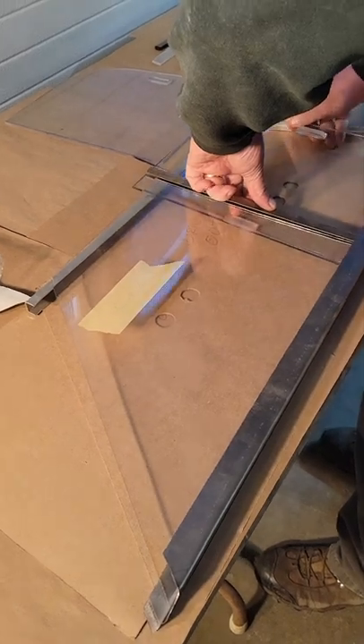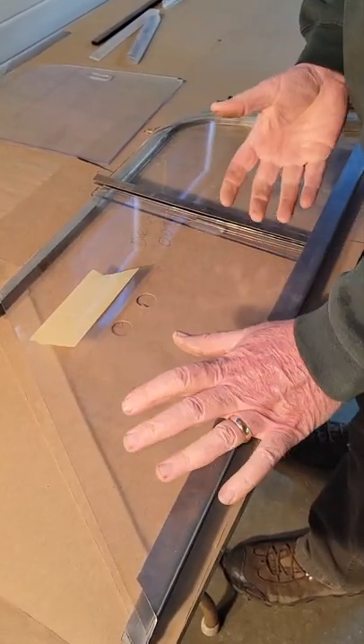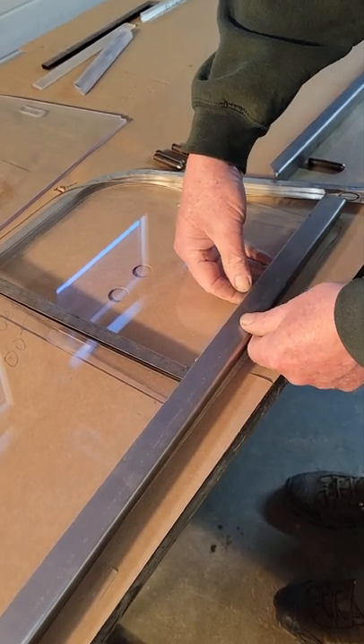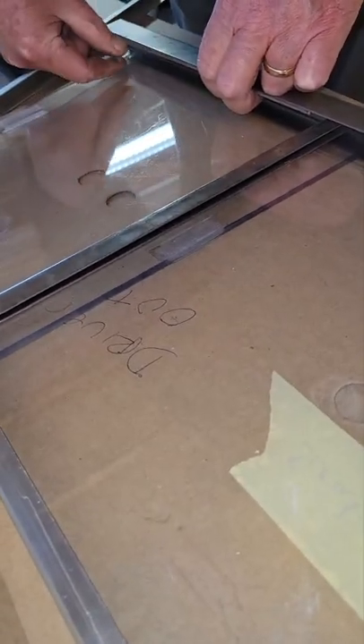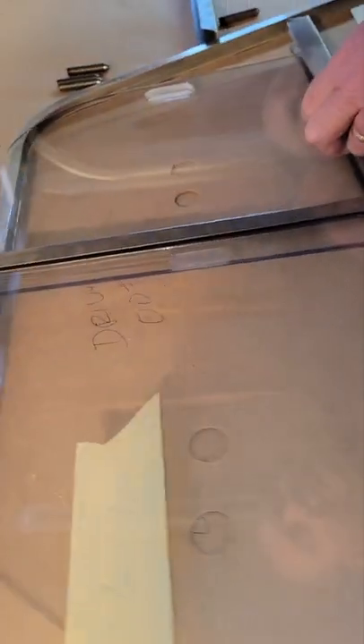Because the front window is on the outside, the back window goes on the inside. This also gets a spacer that comes up inside here to space it behind this channel, so now we've got a space on the back side of this to act as a slide for the back window.